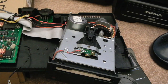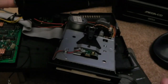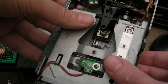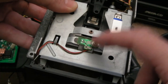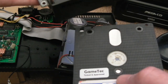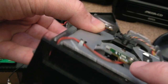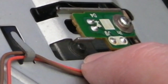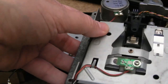The other thing I'll point out is I've just tested my other drive — let me show you this one's working as well now. There's another issue worth pointing out about these drives that I've not covered yet. This sensor here — as I talked about in the first part — is to do with timing, not RPM timing. It's used to find sector zero. In the center of the disc there's a little hole, and as the disc spins around it breaks the beam of light from here to the bottom sensor down there. You can get dust into the bottom bit — there's a little cavity with a little hole, like a little metal thing. This drive had been detached previously.